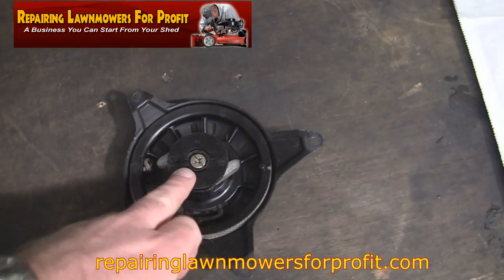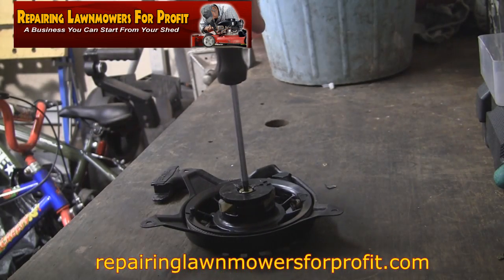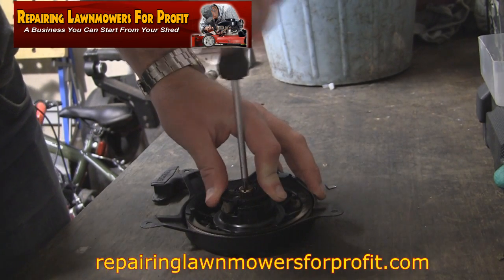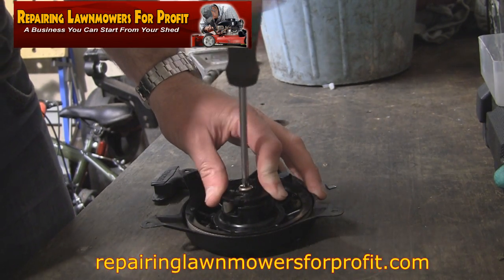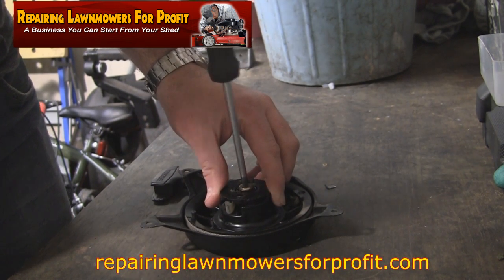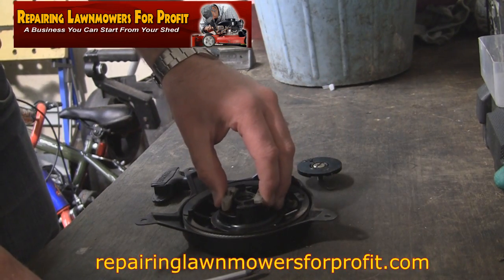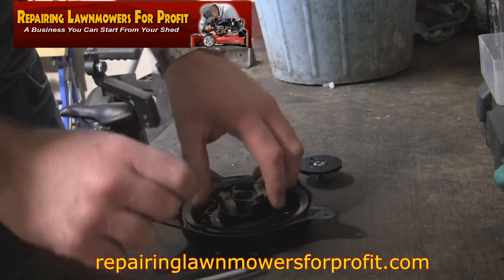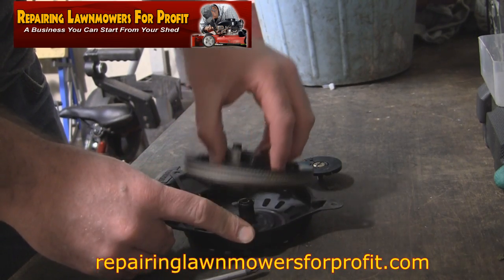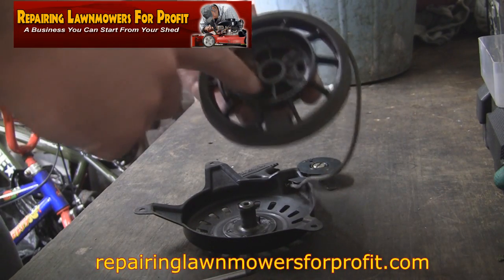I'm going to have a look around and see where I've put this old one — I'm hoping it's still on my bench and I haven't binned it. Hopefully I can work out which way it went or use the diagram. First of all, I'm just going to unscrew this and take this part of the recoil apart. As I said, if there was a spring in this, you don't want to be doing this without safety glasses. There's a lot of tension in the springs normally in here. I'm just going to unscrew this part, see if we can get this off. These actual parts here normally remove — they actually lift out. This whole part should lift out as well. And I basically need to fit the new spring into this part here.